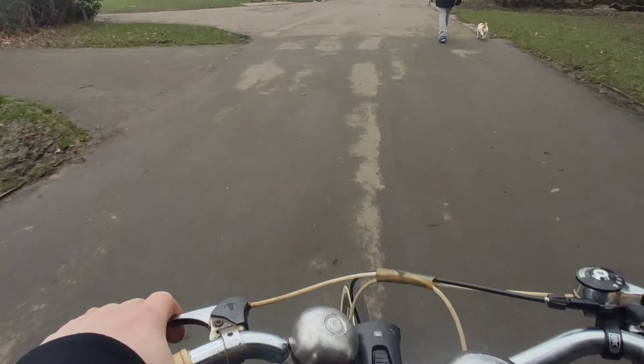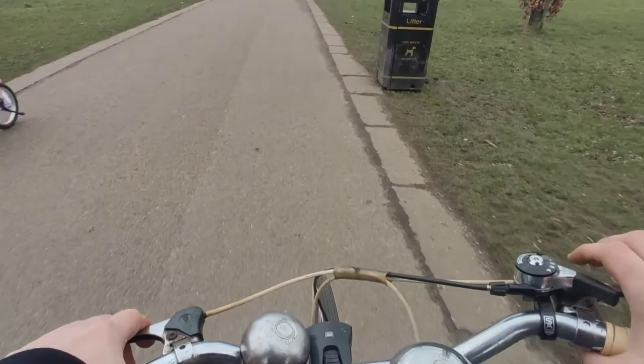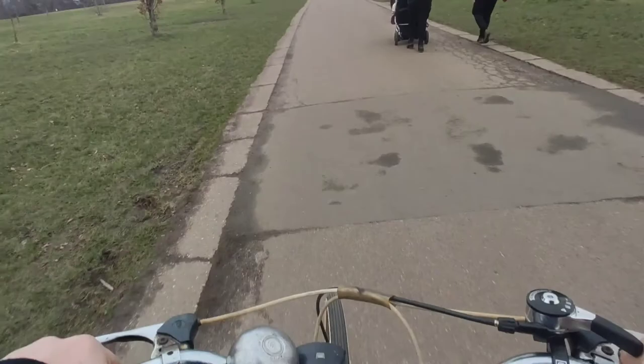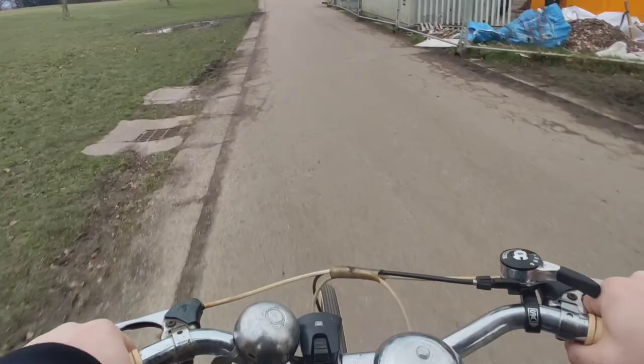And yeah, ride's great. Possibly may upgrade the rear chainring, the cog. I've got a 20 tooth and a 22 tooth in the parts box that I've ordered. The one currently on is a 17. I haven't taken it on any hills, so I'll see how it is first. And I also need to replace the pedals, because the right pedal is particularly wonky, so it's not very nice to ride. But overall, the bike's great to ride.